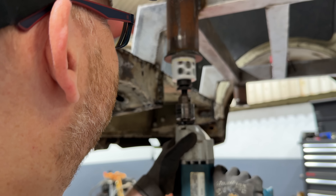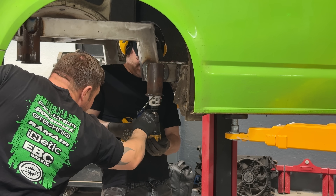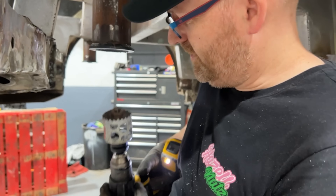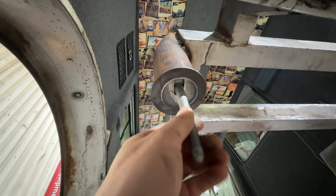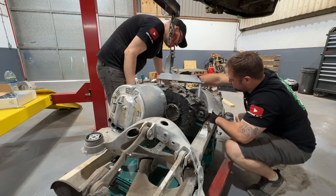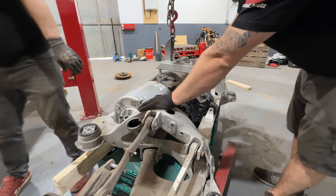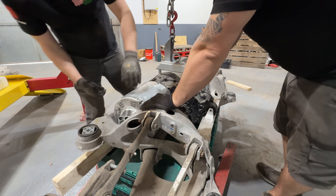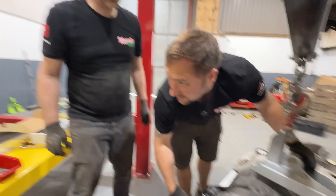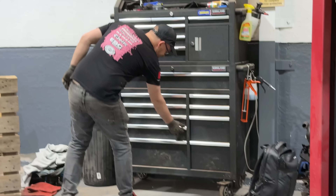We took the decision to let Carl play with the hole saw, in which he made it look super easy — might have been because neither me nor Nick were actually doing any of the work. There's one done! This new slotted twizzly design looks like it'll do the job. Now be really careful when dropping these motors or taking them out of these subframes, because that low voltage connector on the end of the inverter is super easy to smash off and they require a lot of soldering to fix.